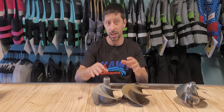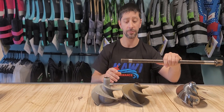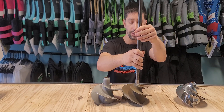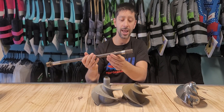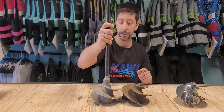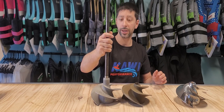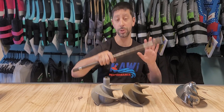Plus, it's actually stronger because of the additional engagement. I have a drive shaft here from an Ultra 300, which you can see has full engagement there, but on the 310, these splines actually come down a bit further here. So they engage more on the 310 — instead of sitting all the way here, it actually sits here more on the 310, which is really cool.